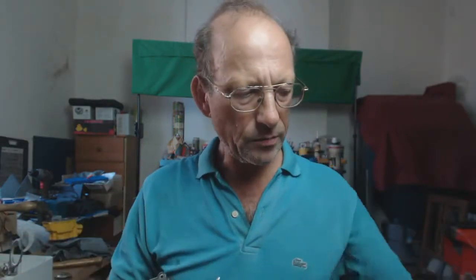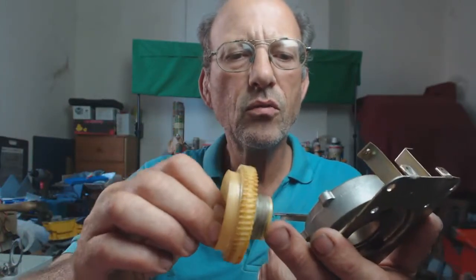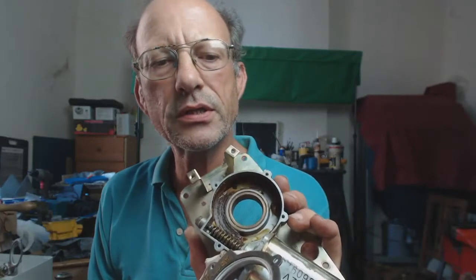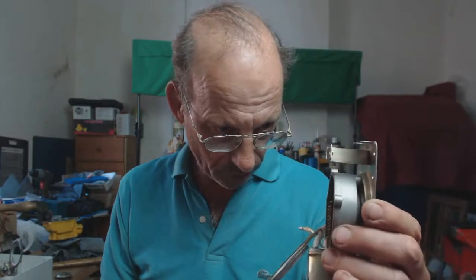Here's the gear — it's plastic. If you can get to the driver's side and the passenger's side, the driver's side is going to be the most used. If we take the gear out, you can see how it's all worn here. That's what it looks like inside. It could do with a touch more grease, and it's got a brass or phosphor bronze bearing.